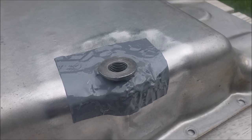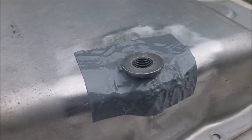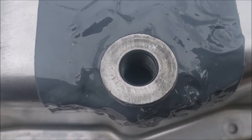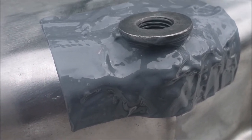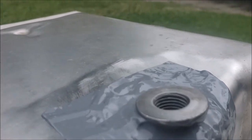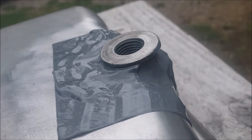There's always got to be a plan B. I put the pan on, put my first couple of quarts in, and pretty soon I started getting a drip every five seconds. It was probably around the 6-to-7 o'clock position — which is right where you don't see the good penetration, which is also why I built everything up so much trying to band-aid that, and it didn't work. So good old JB Weld — I would have liked to use the quick-set but it's not as strong or temperature resistant. There's plan B, we'll see if it works.